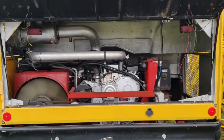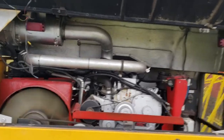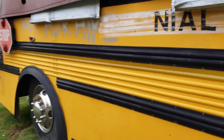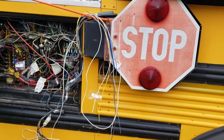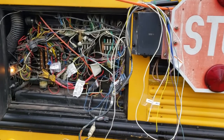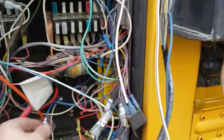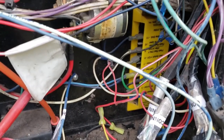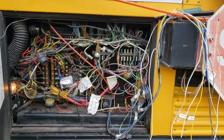I got the engine started. I just had to ground wire number 29. I grounded wire number 29 — the blue wire right here for the emergency door — and grounded it to that little lug right there. Then I went in and started the bus and it fired right up. That's progress.